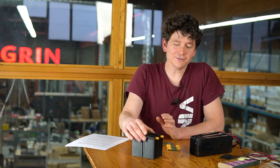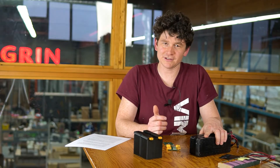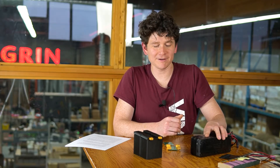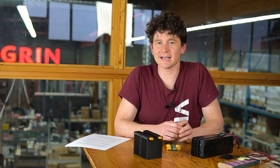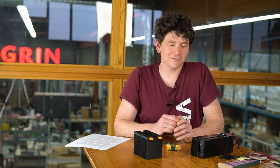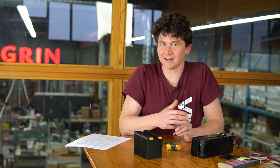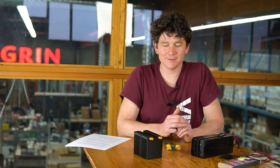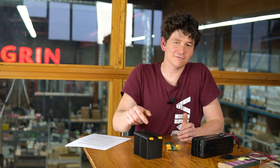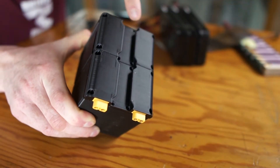The enclosure design also features an integrated rail in the lid of the battery pack, which solves another pain point of the original LIGOs — how do you mount them on the vehicle. Most people traveling with folding e-bikes would simply put the LIGOs in a loose soft bag, but for somebody making a factory scooter or factory e-bike that they want to advertise as air-travel friendly, they need a solution where the batteries really click and lock into place. With this integrated rail, the batteries will have a secure mounting to the chassis of whatever vehicle they're on.